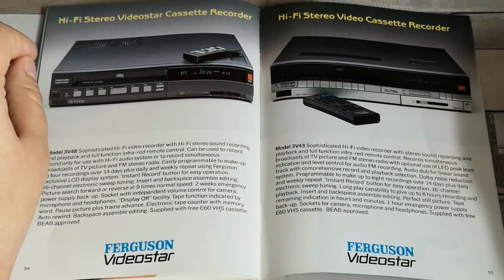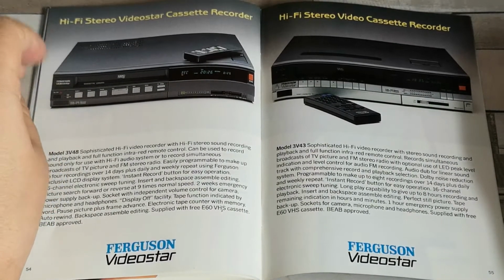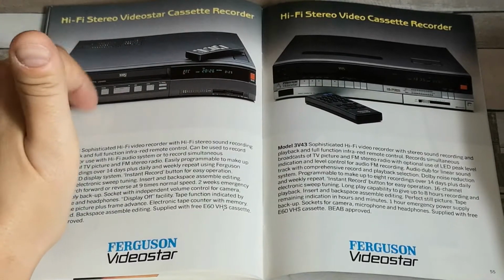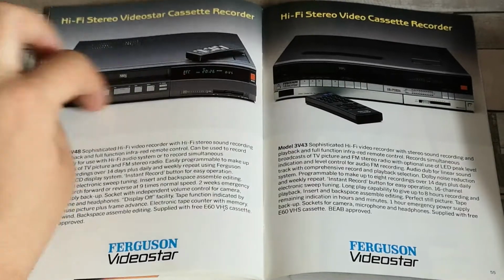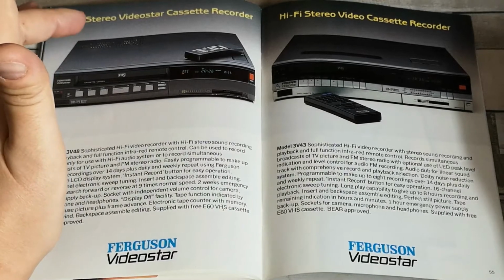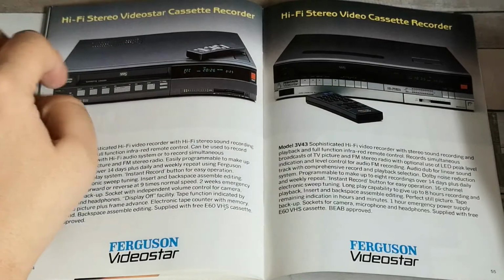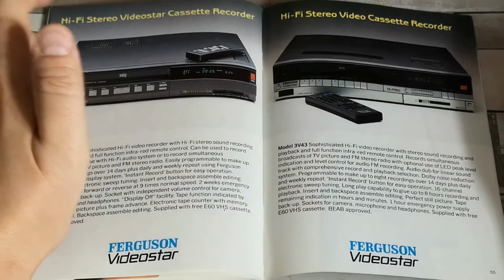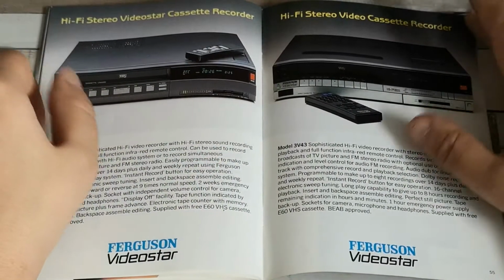But, again, we've moved up a generation because that is a very slimline VCR for the day. And really, video recorders didn't really get any smaller than this throughout the 80s, unless you went for the portables, but the home decks didn't really get any smaller than this. Internally, they became everything on one board, effectively, but the actual overall format, which was governed now primarily by the tape transport size, you didn't really get any slimmer than the size that you got on this one.